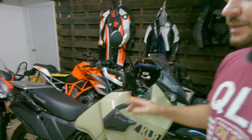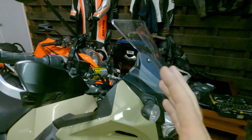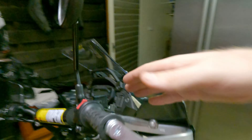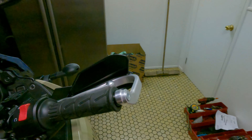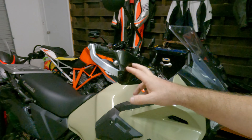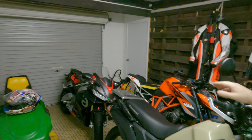One of the great things about Bark Busters is they're lightweight — still strong as buggery, but lightweight. The bolts and everything are the perfect size, very easy to fit. Same process: just pop that in — it's even got little grooves on it so you can't stuff it up, which is fantastic. It helps pull it tight. Then we've got the washer as well. All good quality. If it's a bit fiddly to get in the hole, just do it like that and slide it in. Perfect — absolutely perfect. It is slightly more inboard on this side than the other, but that's alright.